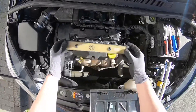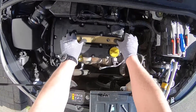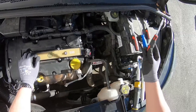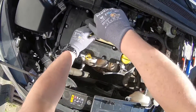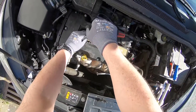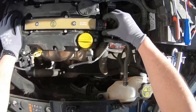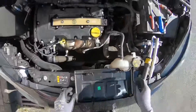Place the ignition coil back in position, push it down, and aim it right — but this is not so hard to handle. The spark plugs are reassembled, and the ignition coil is nearly reassembled too. Now tighten the two top screws: first with a screwdriver, then only a quarter rotation with the socket wrench — not many Newton meters are needed. Then plug in the power supply connector and lock it with the red lock on top.